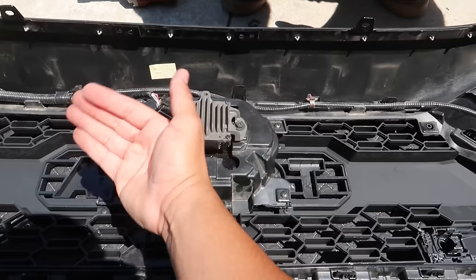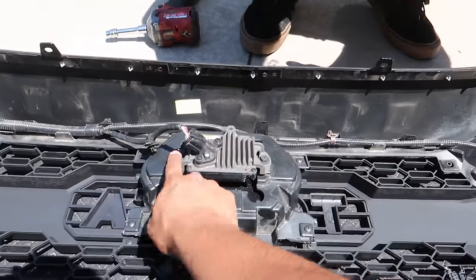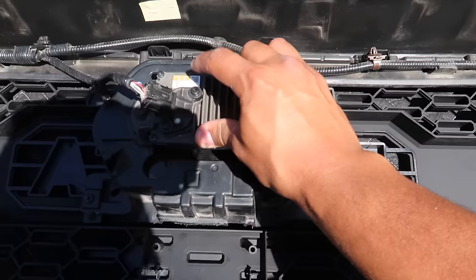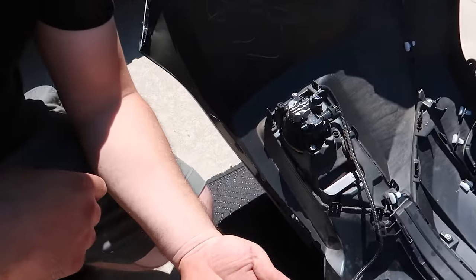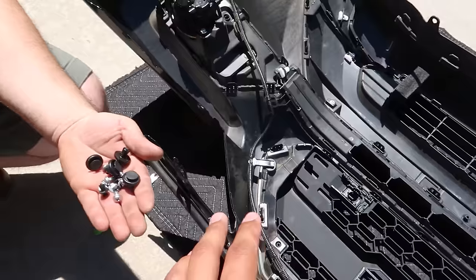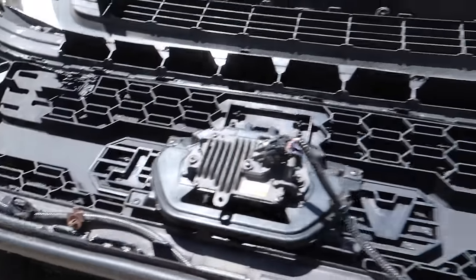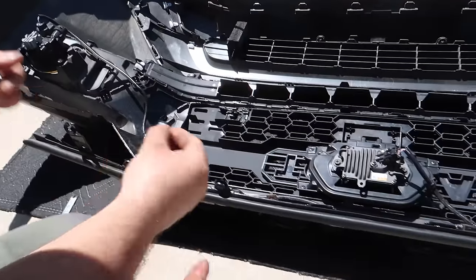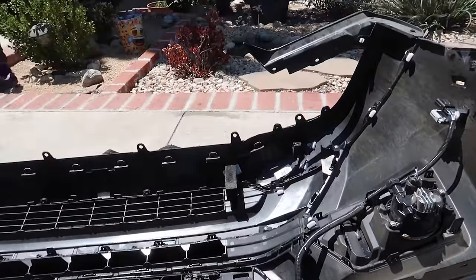Make sure your connection is actually on the left driver's side — I made a quick mistake on that. Super easy fix: just remove the two screws holding it down, flip it, and now we're good to go. Make sure the Toyota emblem is facing towards the top and you'll be good. You're going to have some extra screws and clips from the top section we cut off — don't worry, the clips you can reuse so there are no empty holes. The extra screws you can either toss or hold on for something else. Just clip them in — they have no use anymore but we just put them back so there are no empty holes.